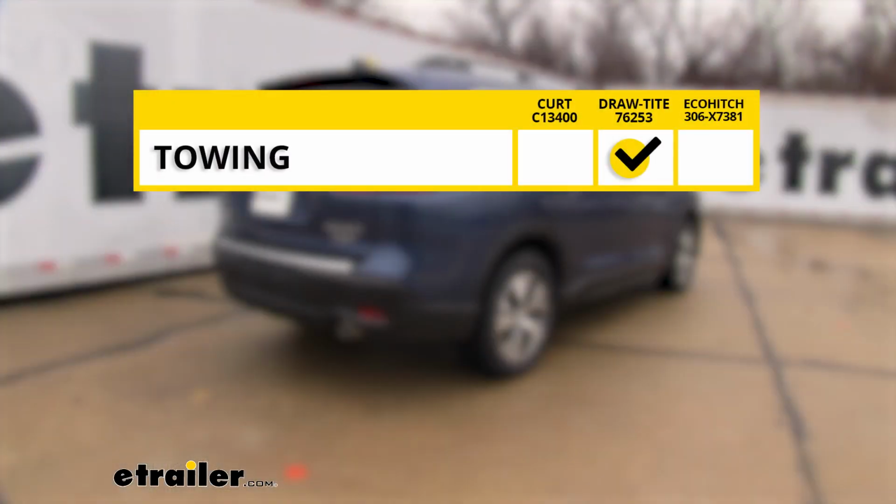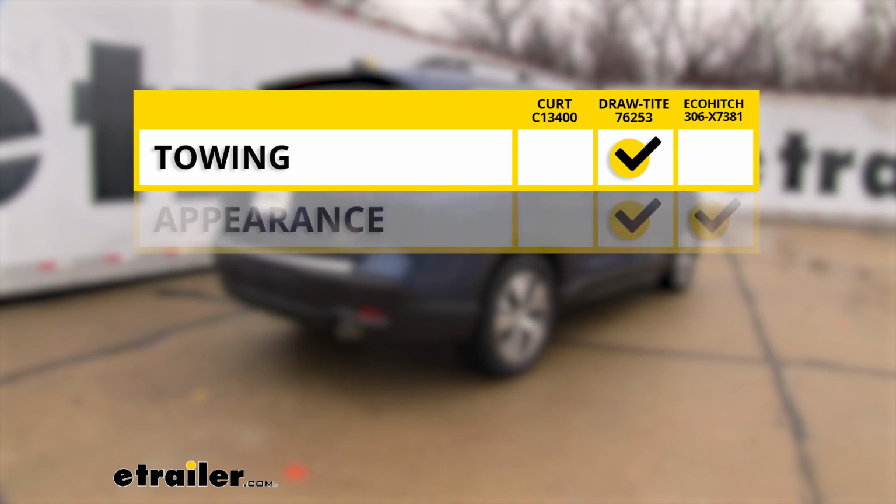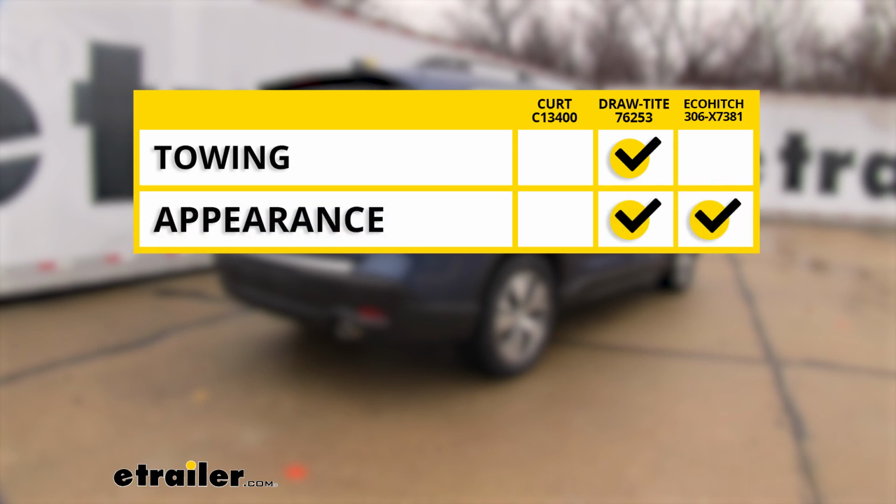So when it comes to towing, I'm going to have to give that to the Draw-Tite because it has the highest weight ratings, can work with a weight distribution system, and also has better clearance than the Curt does. When it comes to appearance, I'm going to have to tie that between the Draw-Tite and the ecohitch. They're both going to be hidden behind the bumper, so you're not even going to know they're there. The only small difference between them is going to be the finish, where it's a black powder coat finish on our Draw-Tite, and our ecohitch has a textured black powder coat finish.